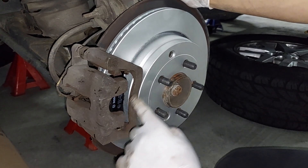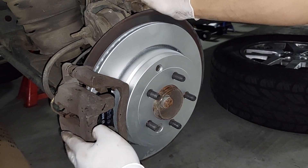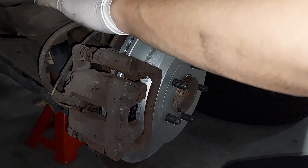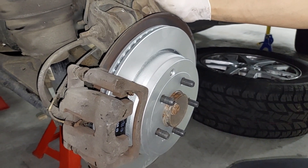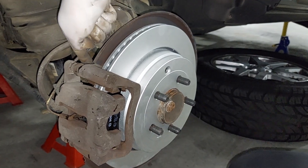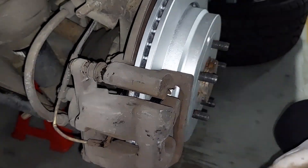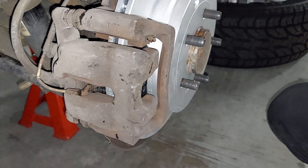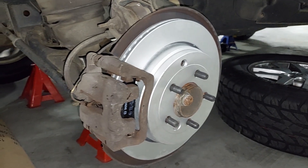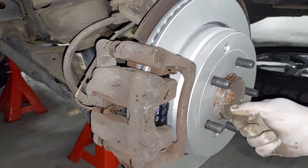It's all done now. I've changed the rotor and the pads. In my next video I'll upgrade the interior electronic parking brake as well. There was a bit of a drama putting the brake pad sensor back on but I managed. Torque specs: the disc screw is 35 Newton metres, the caliper bracket is 115 Newton metres, and the sliding pin bolts are 35 Newton metres. Go back, put the reservoir cap on, lower the vehicle — and that's how the rear brake disc and pad change is done on the Discovery 3.